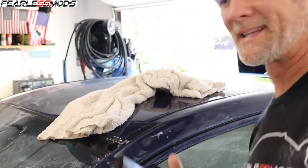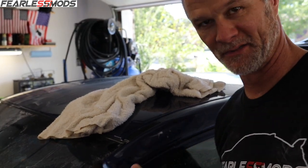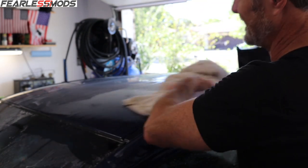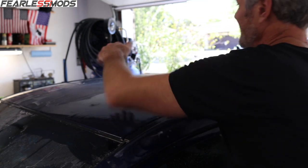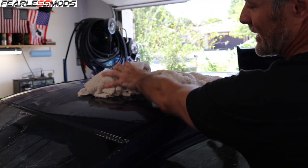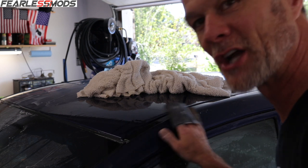The thing to keep in mind here is that it's easy to get deceived because with the water on it, it looks beautiful — the water is kind of taking the place of your clear coat. But make no mistake, you are sanding it. The top is a good indication: you are dulling the surface. So don't get into areas where you can't reach with your buffer, because you are going to have to buff this smooth again and give it the shine.